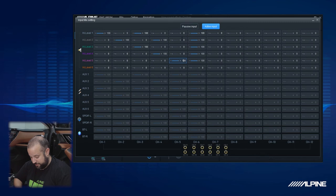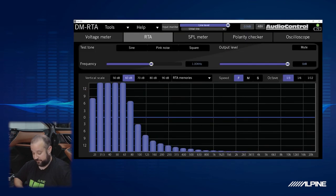And I am going to leave some of the door woofer signal in there. That way they can go up a little bit higher, so we're going to get a little more out of that subwoofer. So I don't want 100% of both left and right. I want to combine the two. Since half of 100 is 50, we want 50% of left and then 50% of right. And as you can see, we'll leave 100% of that sub signal.